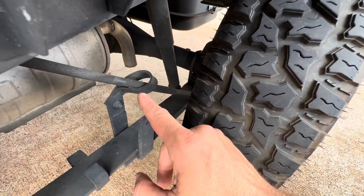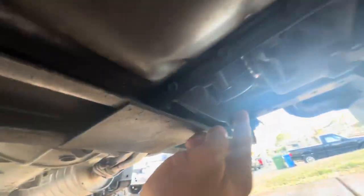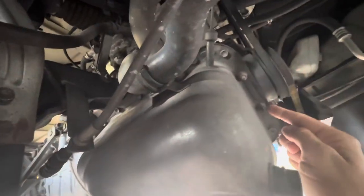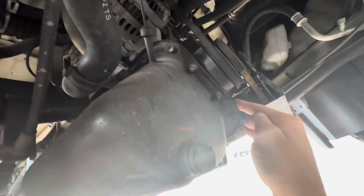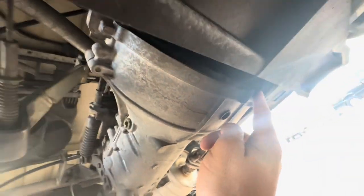Behind the muffler they've chopped off the exhaust where it goes behind the rear solid axle and did a dump pipe or turn-down pipe just before the rear axle. For maintenance, you want to look at the oil filter to see how clean or dirty it is — you can generally tell if it's had routine maintenance. You can check the oil pan gasket from the driver's side by running your hands around it to check for oil leaks. You can also check the rear main seal by looking where the transmission mounts to the engine.